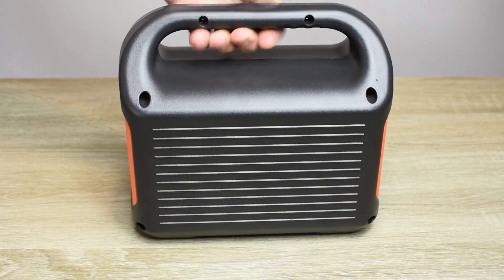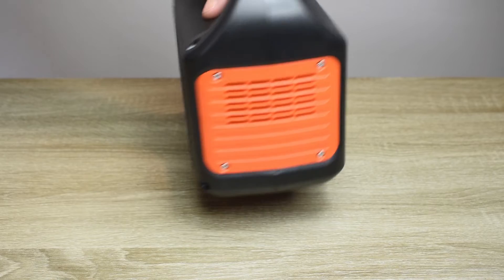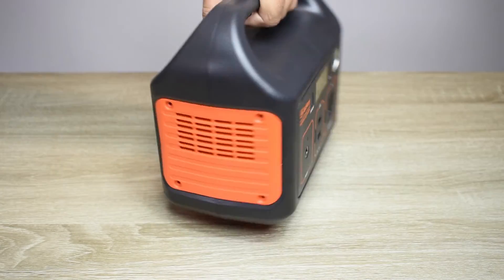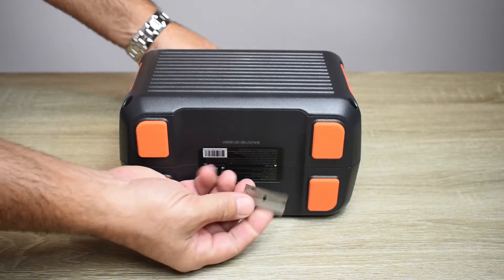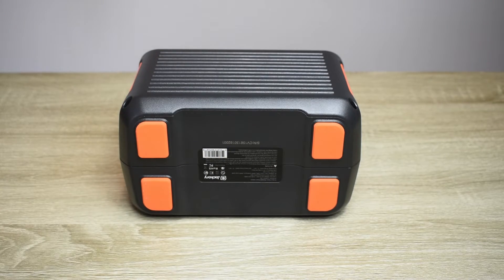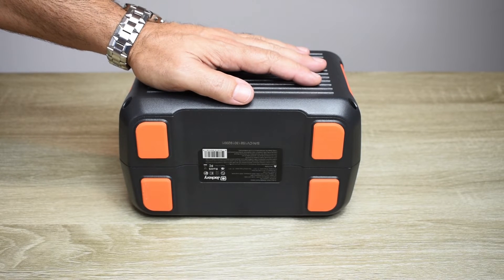Let me turn this around. Over here are the screws on this unit — they're all Phillips. On the end of the unit you can see there are four, as well as on this side. These require a hex key. All the screws have been removed from the side panels as well as the rear side. Using a razor blade, I cut straight across the seam across the label at the bottom. Keep in mind, if the unit you're working on has warranty remaining, you are going to void the warranty by making this modification.